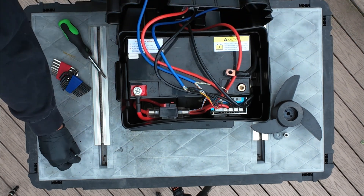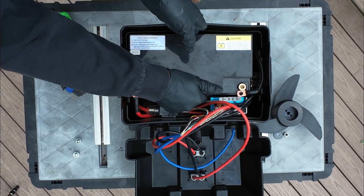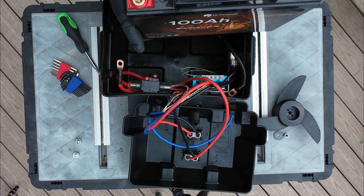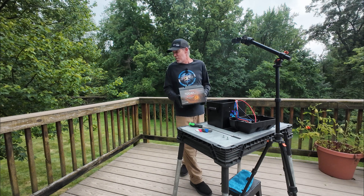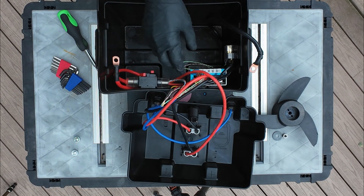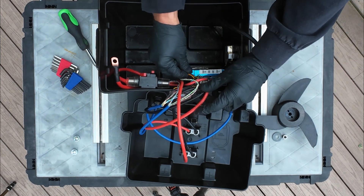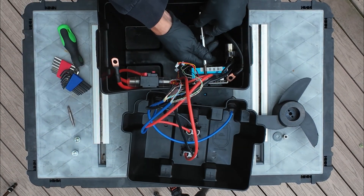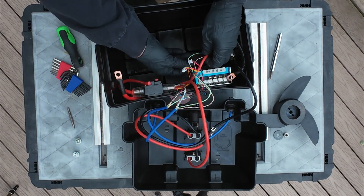Negative post off. Have to remove the battery to get to the pulse width modulator — it's not that big of a deal. There's our Dakota Lithium 100 amp hour 12.8V mini — this thing is small in comparison to other 12-volt batteries of that capacity. Now we're going to remove the pulse width modulator; I've got an exact replacement. Remove the power connectors and the pulse width modulator is now disconnected.